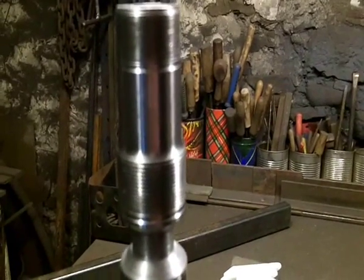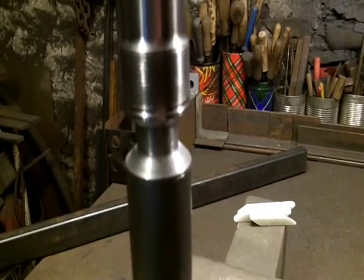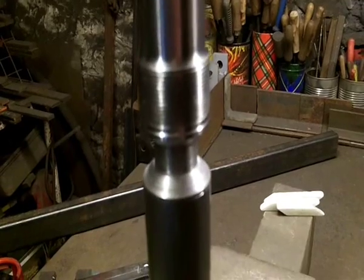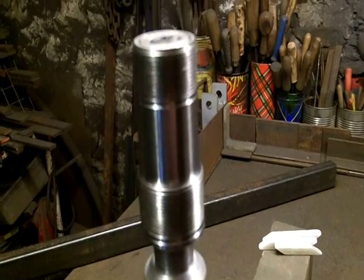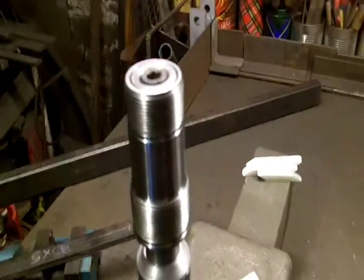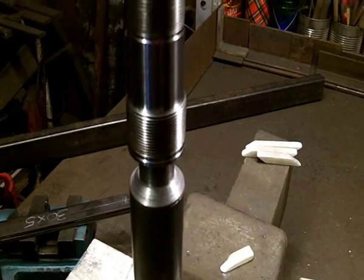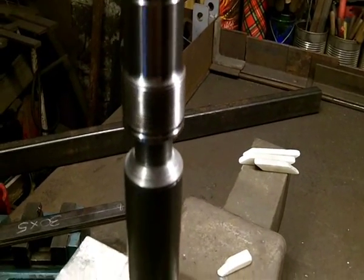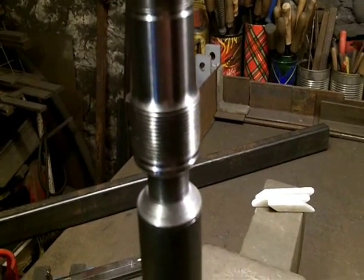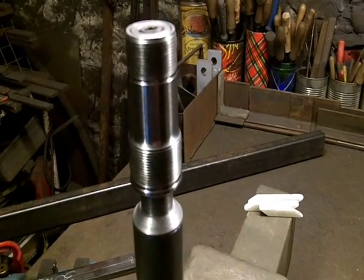I'm having to chap it. I've maybe been chapping it now for 3 or 4 minutes just to knock it down sort of 30 odd millimetres, just over the inch. So as I say, it is fairly tight, and when it's all bolted in place with the top Allen bolt as well, it really shouldn't warp or move at all when I put the weld round it, and that was how I designed it. So we'll push on and show you as we sort of progress it a bit further.